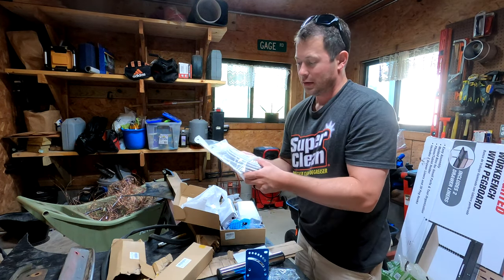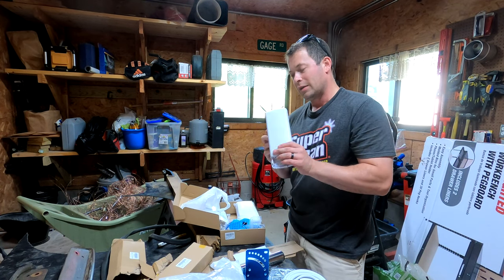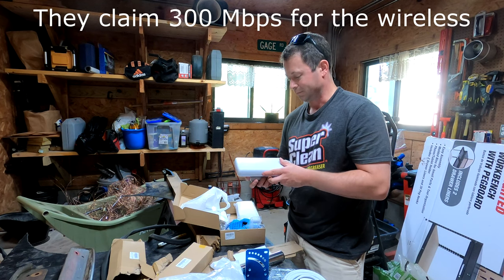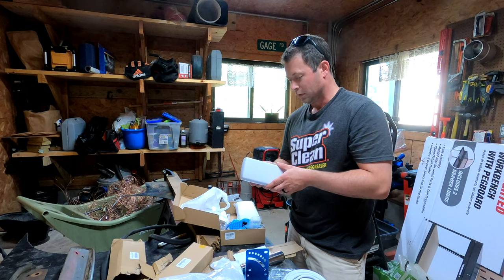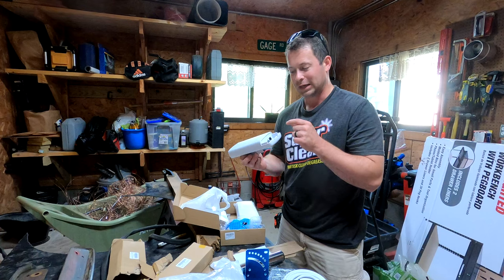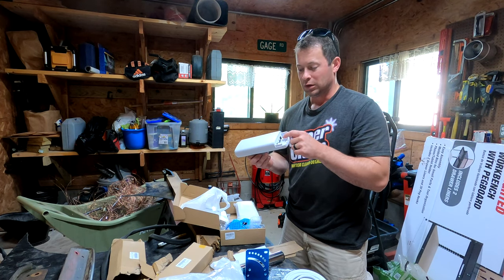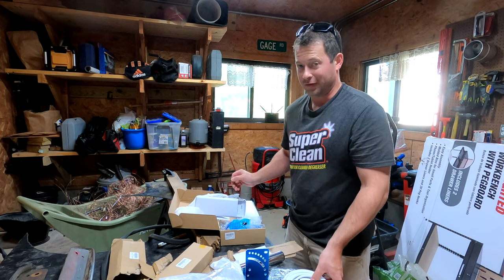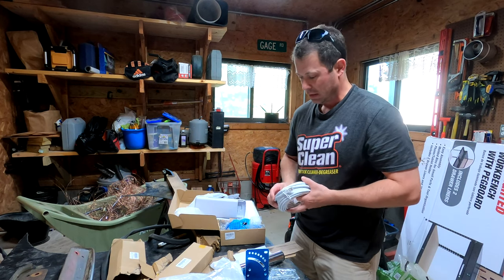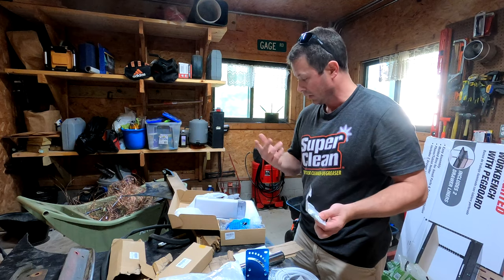The last thing I bought was Ethernet cable — a longer one. This was actually a Cat 8, which is overkill. It only needs to be a Cat 5e, because the downside to these devices is that even though they are 5 GHz with several hundred megabits per second Wi-Fi capability, the Ethernet port is only a 100 megabit per second port. So that's your bottleneck — that's as fast as these can go, and you only need Cat 5e to achieve that. Some higher-end units costing several hundred dollars do support gigabit speed, but these and my other ones are just 100 Mbps. The cable does come with little fasteners if you want to secure it to the wall.